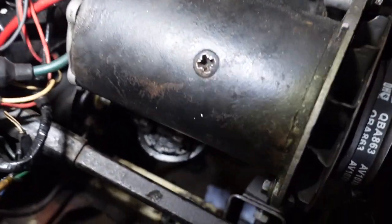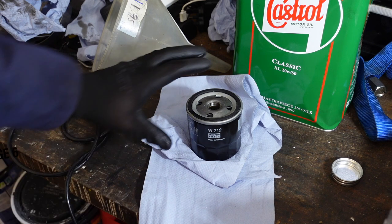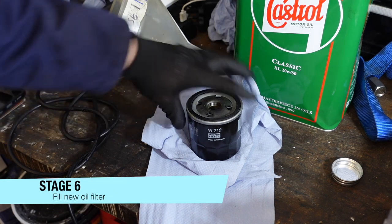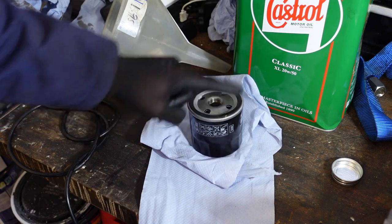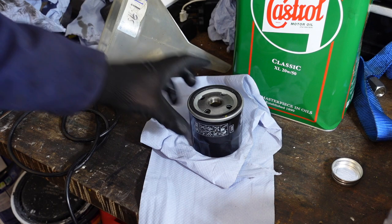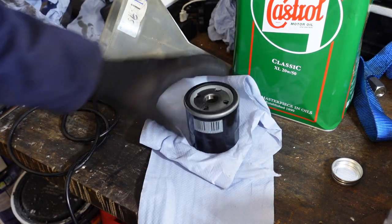She's off! The oil filter is off. The sump is still dripping, so we're now going to fill up the new oil filter. We're going to fill it up as much as we can with motor oil, and we're also going to smear some oil around this rubber o-ring so that when we tighten it up to the car, it helps mate the two surfaces.